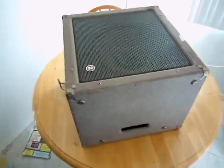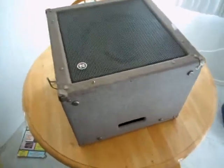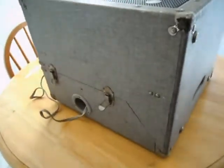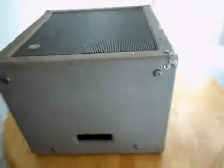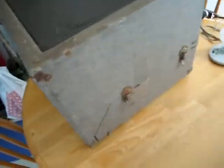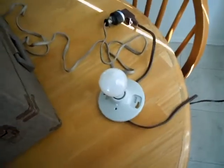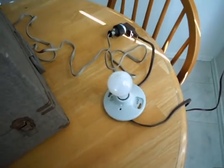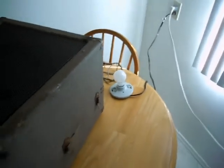I'm not exactly sure what the date of it is, but perhaps someone could help me out. It's definitely been well worn — lots of wear and tear here and there, lots of scratches and markings — but the actual covering of the case is still present. I've got it hooked up to a poor man's variac, or a light bulb in series with it, whichever way you want to present it. I'm going to fire it up and see what happens.